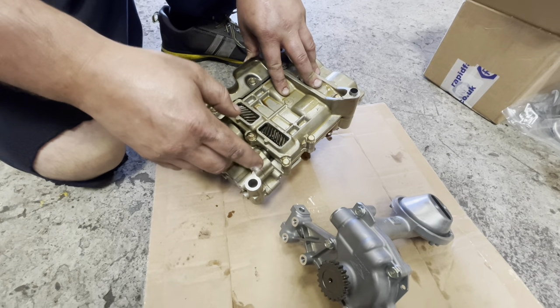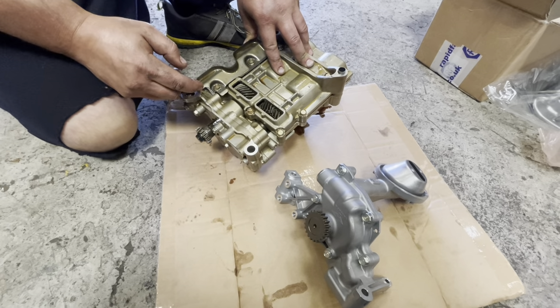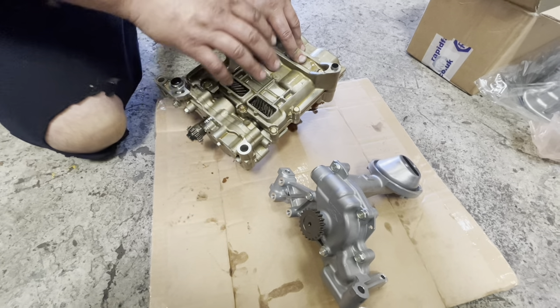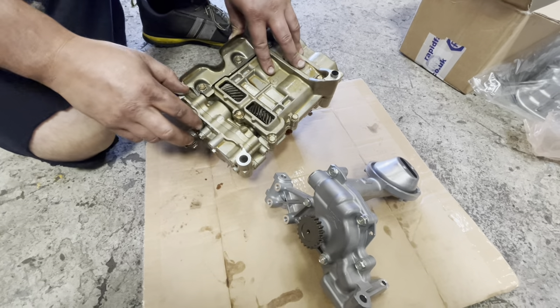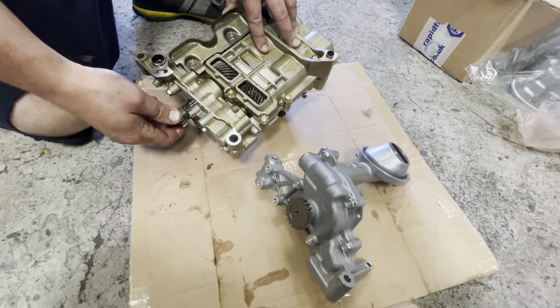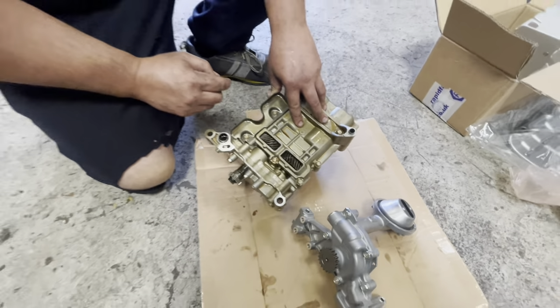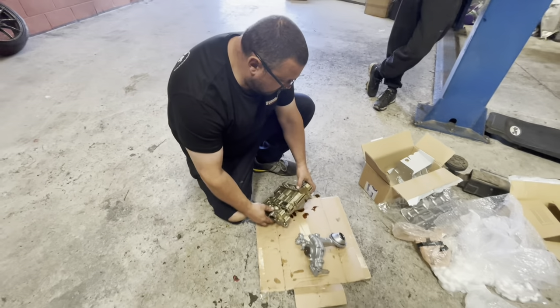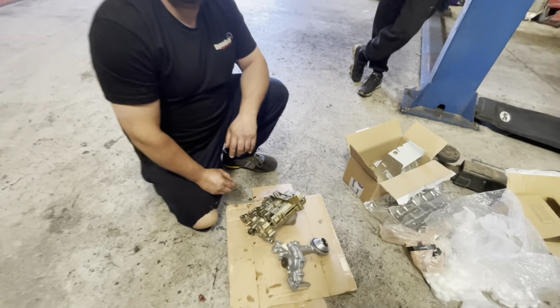The main reason in my opinion that you would do this is so that you can fit that baffled sump, because obviously you can't fit that baffle with this pump due to the size of it. So that is the main reason for me why I would fit it — it wouldn't necessarily be for proof of gains, but we will test that tomorrow when we run the car. Yes, because that's the plan — we're going to dyno it. Okay, I think we'll come back to that when we've got some bits bolted back on.